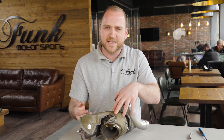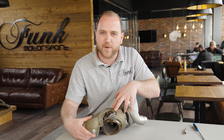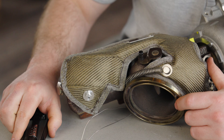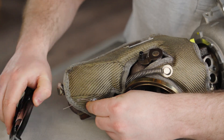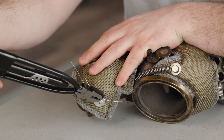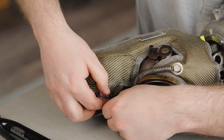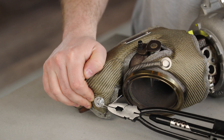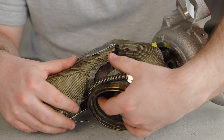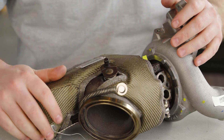However, you will notice the rest of the manifold portion is a little bit floppy. Poke that around the manifold, and then using the lock wire from earlier, we're actually going to secure that onto the final anchor point. Make sure the blanket is tucked right out of the way, and then you can either use a pair of pliers or a lock wire tool. Now that it's secured in place, you can either lock wire it as I have or cut the ends — it's entirely up to you. Manipulate the blanket again just so it doesn't interfere with the actuator or touch anything hot like your downpipe. Once you've done that, you're done.